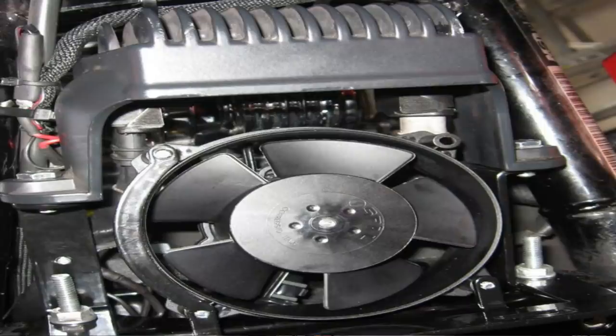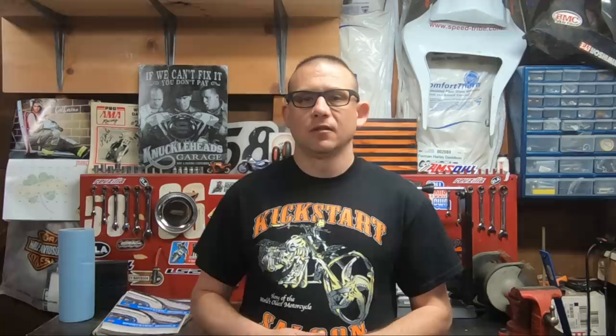So who makes oil coolers and which one is right for you? When it comes to fan-assisted oil coolers, you could get these through the Harley catalog or from Jag. Jag has some good options, but for fan-assisted models I really like Ultra Cool — they have a really clean package for their fan-assisted oil coolers. For a fan-assisted oil cooler, expect to spend about five to six hundred dollars depending on whether you get a single or dual fan and how big an oil cooler you get.